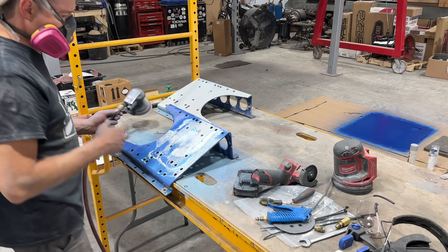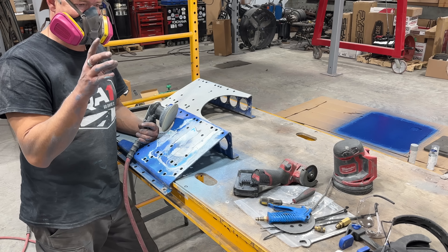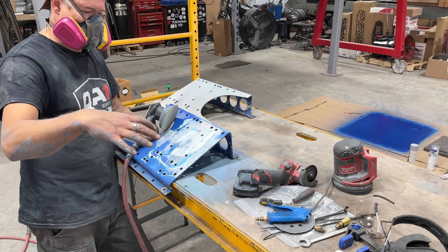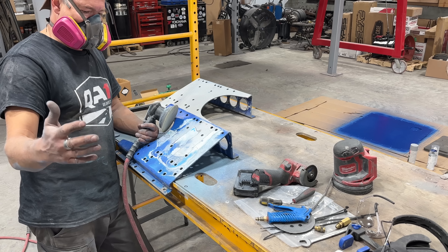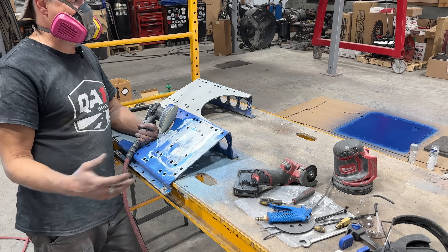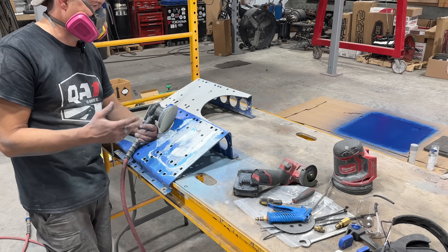Now I've got two hours to kill before I even put the clear coat on. In the time lapse there, the number one rule of painting is don't stop or don't try and go back. The problem I had with the spray bomb was the air was coming out and as the can was finishing up, it would kind of spit and sputter. But if you make a mistake, just try and go over it — you can always sand it out later. Worst case scenario, you sand the whole mess down and paint it all over again.